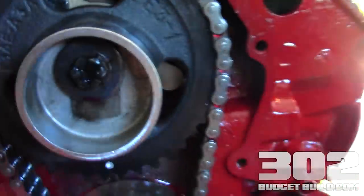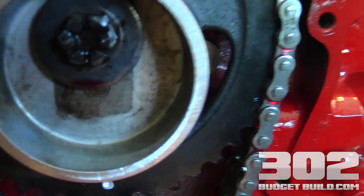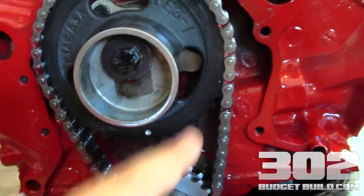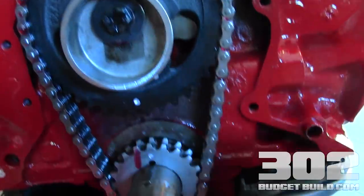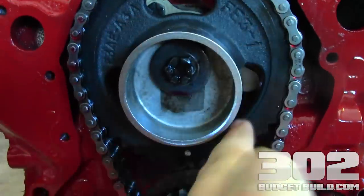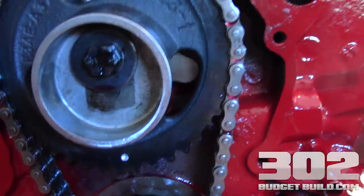What you're looking at here is this little pulley-looking thing on the end of the timing gear that's kind of offset. You can see it's bolted more toward the top, and if you look in here you'll see evidence of the pin that ran through the camshaft. This is actually called a mechanical fuel pump eccentric, and what this does essentially is every time the cam spins and makes one full revolution it pushes the lever of the mechanical fuel pump up and down. The mechanical fuel pump rides in this direction here and the lever kind of rests on it. So every time this oblong disc is moving up and down it's pumping the fuel pump lever up and down, which causes the pump to actually work — and that pump is what pumps fuel into your carburetor.